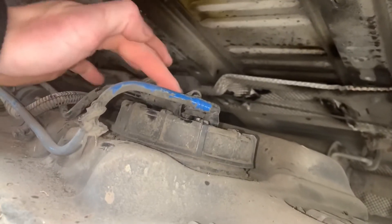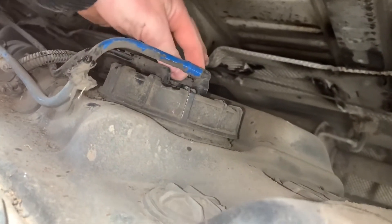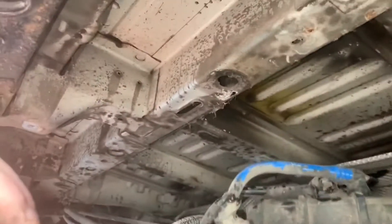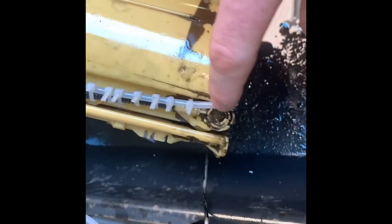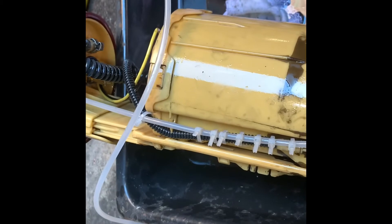So it's down. Got to get this pump off - take this pipe at the back which is the black one, the blue one off. Get that one off in there - it's a bit tight - then the connector, and hopefully it drops down a bit more so I can get this off and just lift the pump out. I've got it out, drilled a hole on top there. The float sits lower than the actual end of the pipe so it should never suck the tank dry. Chuck it all back together - it's done, it's all plumbed up.